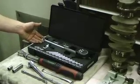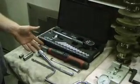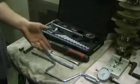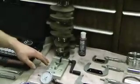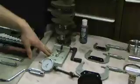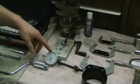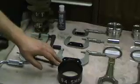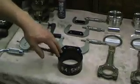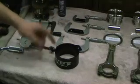The first tool we have here is a digital dial bore gauge. The next tool we're going to need is a torque wrench — this is a Snap-on digital. You're going to need your common hand tools and wrenches, a ring filer to gap the rings, a rod bolt stretch gauge tool, machinist micrometers, and some kind of ring compressor. These are ARP ring compressors, which are really nice.